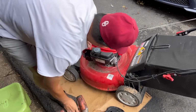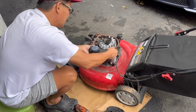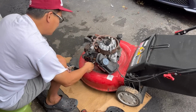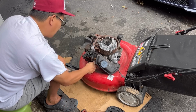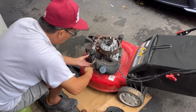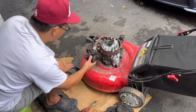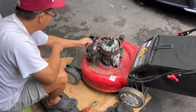Alright, 2. That's good. This thing comes right off. Look how rusted that is. And then you can remove the gas tank easily. And we'll disconnect the fuel hose. I'm going to pinch it off with these vice grips. Gas tank. No fuel's coming out. And this just, oh, look at that. That muffler is really, really rusted. At least the guard is.